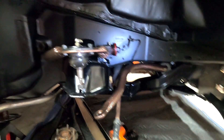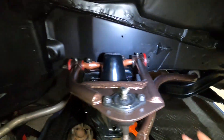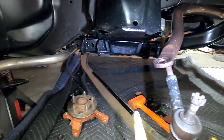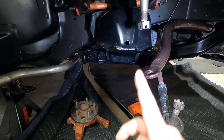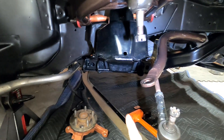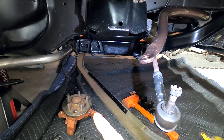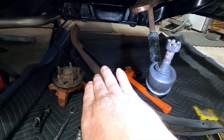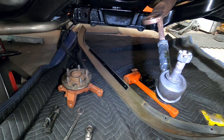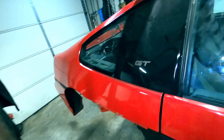Getting the upper control arm in place. I had the lower control arm but it was actually for the other side — I was thinking the arms were symmetrical, but the bottoms might actually have some caster built into them. So I took that one back off and I'm going to take it over to Steve and have him verify. At the ball joint side it looks like there's some caster built in, so he'll have to do some measuring to see where we're at.